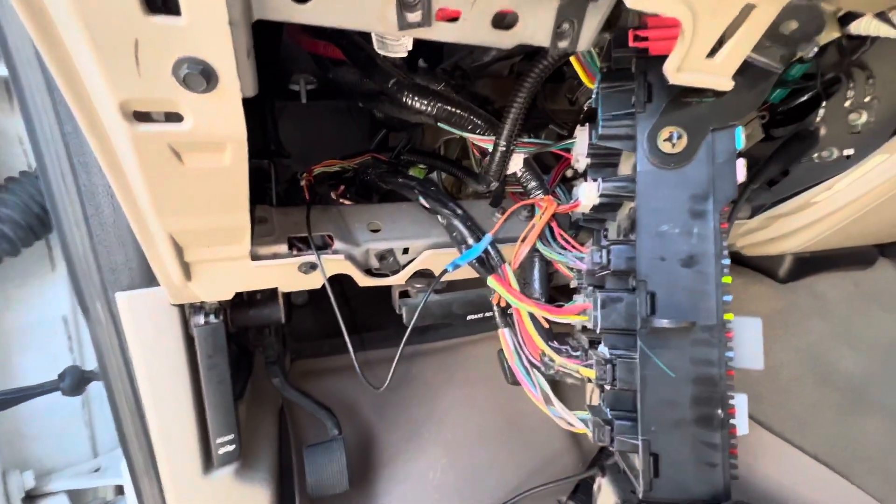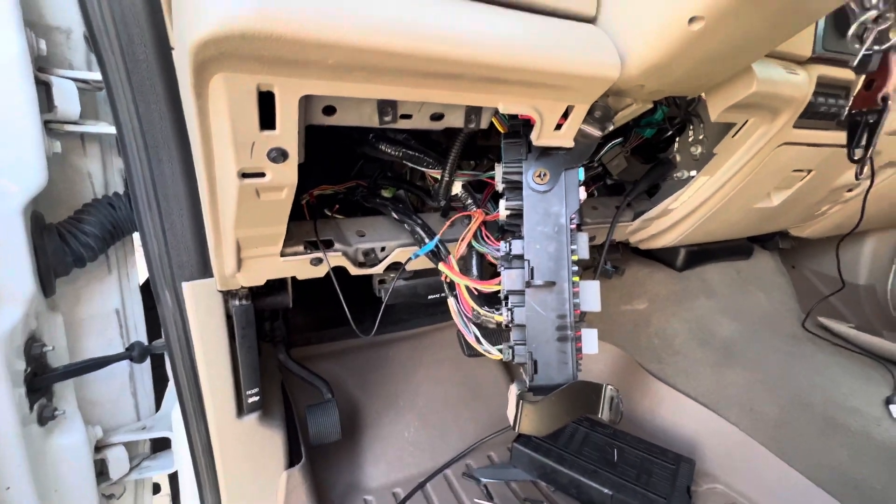It's a relatively easy process, so I'll get this buttoned up and we should be good to go. I got everything buttoned back up, tested it one more time to make sure I didn't knock any wires loose. And just like that, you're done. Realistically, if you get all the wires right, it should be less than a 30-minute job. The only thing that sucks is it's a tighter space down there, makes it a little more difficult, but it's pretty easy. It's a lot easier if you have the factory upfitter switches — there are videos out there on how to do it without them, but that doesn't apply to me. Just like that, you now have a high idle switch in your factory 6.0 Power Stroke with like $2 worth of connectors and a couple tools.